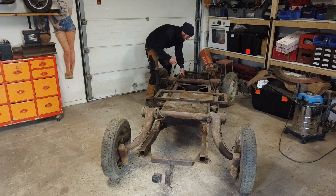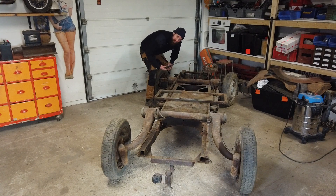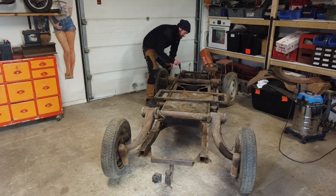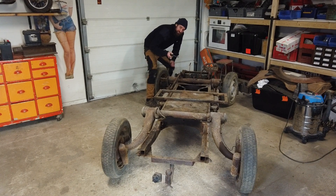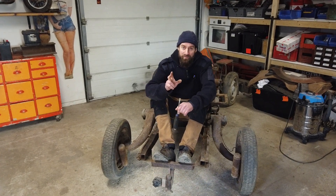You can hear it when I knock on the thick side. It's supposed to be thinner, but it is really thin and I can't really see how thin it is. I can see that slight taps with the hammer are deforming it quite a lot. I don't think it's too bad — I think it could be safe just by grinding it down and painting it. But there's just so much smaller stuff, and there are pretty much three reasons why I have changed my mind about this chassis.